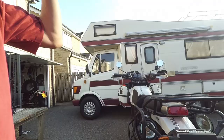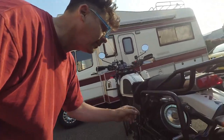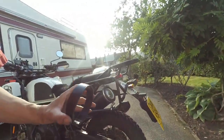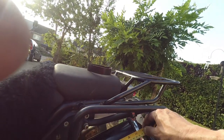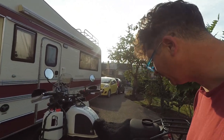All done — much more rigid now. Thirty millimeter spacers there and there to keep it away from the pannier, with nuts on the other side of every single fixing point. With three instead of two clips I had to cut off maybe 25 millimeters from the tube, so it's now about 450 millimeters — just a little bit over actually, but 450 is a good length. If you want to copy that it should be fun, though it takes a bit of faffing around.